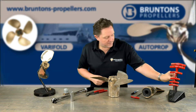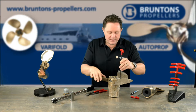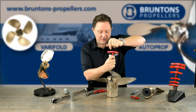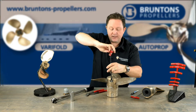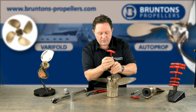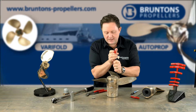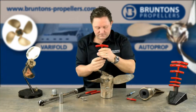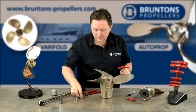Next, M6 allen key and you're just going to take out the bolts that hold the pivot pins. Now if you've been watching any of my other videos, this is the one I actually rebuilt to do the yearly service. So these bolts here have actually been loctited in place with the blue loctite. I've freed up two of them but the last one I didn't do. So let's just get those out — that's the three.